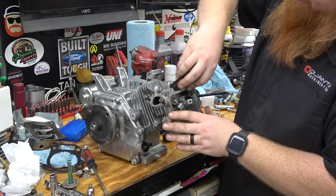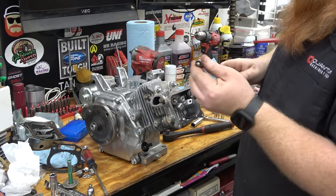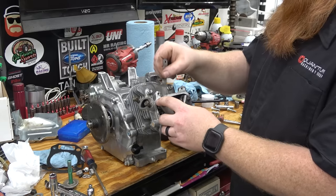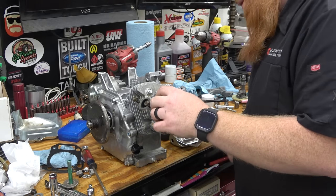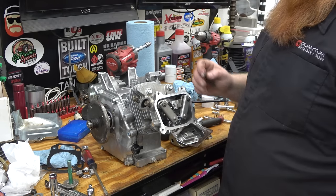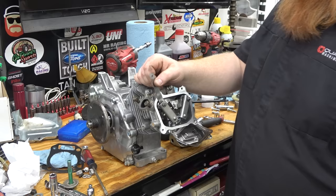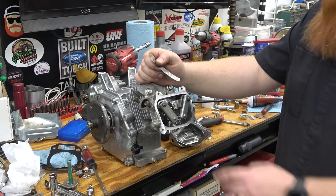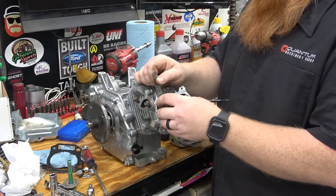We got the spark plug pulled out and we're going to upgrade it anyway. That's a big combustion chamber area. You're going to get more horsepower the tighter you set your valve lash. If it was at five or six thousandths, you can tighten it up and get that much more lift out of your cam. So it's really important that you set valve lash correctly to get maximum lift. We have videos on this on our channel so no need to go in depth here.